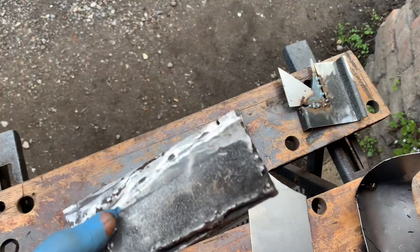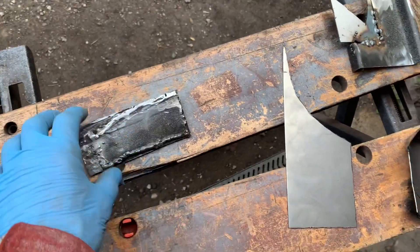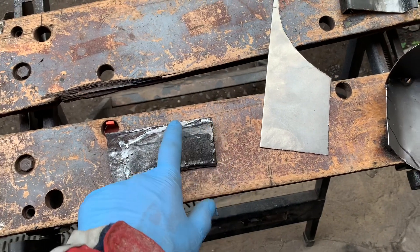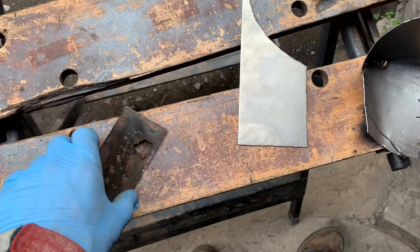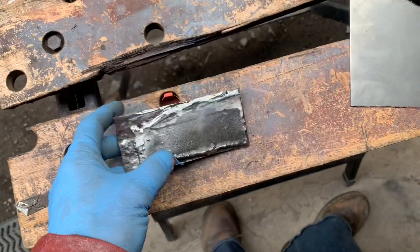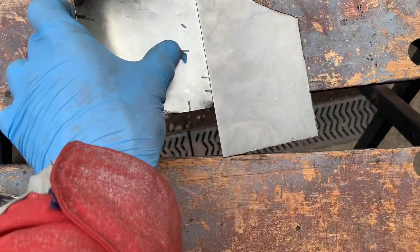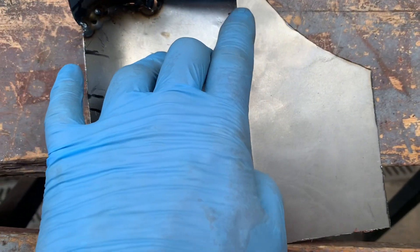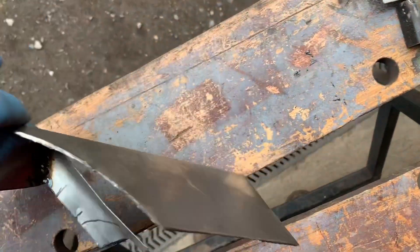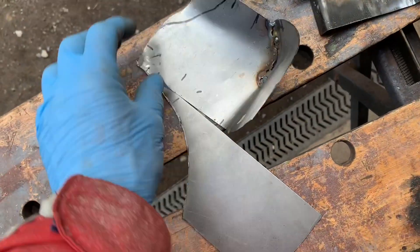I'm just going to spend a moment telling you the difference between lap welding and butt welding. Lap welding is when you've got a hole and you stick a patch over the top of it — the advantage is you don't have to cut the patch to size, it's quick and easy, and you can be pretty confident when you've welded around because you can see the welds. Butt welding is when you cut out all the rust, lay a patch in there, and grind it flat. The potential disadvantage of butt welding is that if you weld two panels together with a very tight gap and you're not able to see the back side of the weld, you might have a perfect line of weld on top, but when you turn it over you might find that the actual penetration on the other side isn't quite as good as it looks on the front.